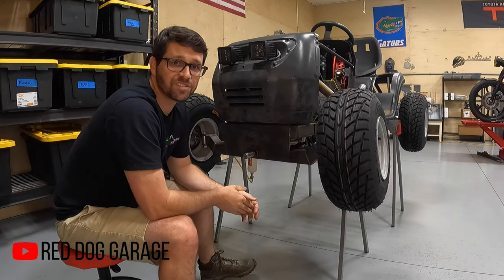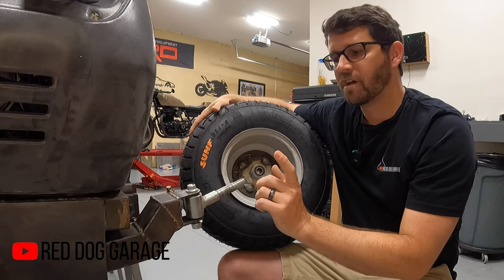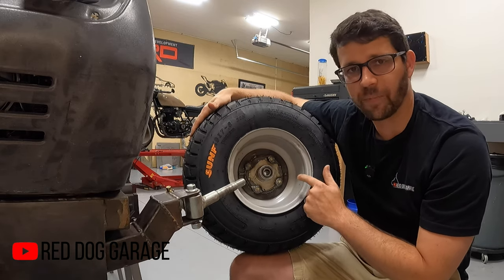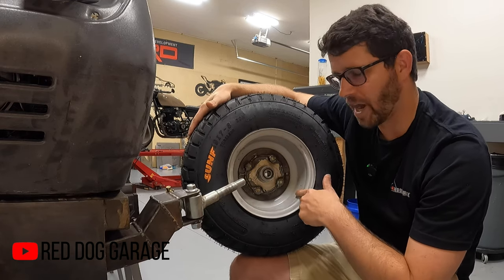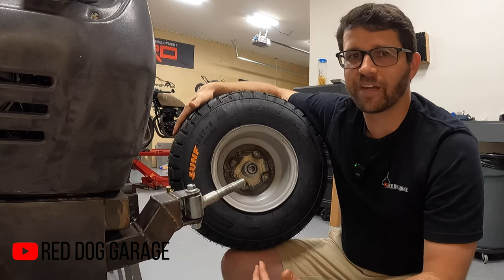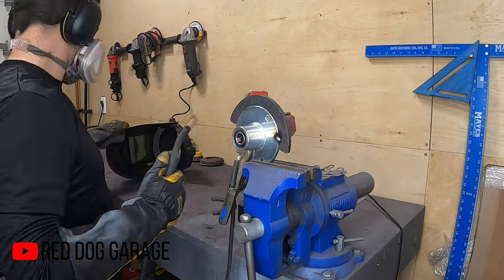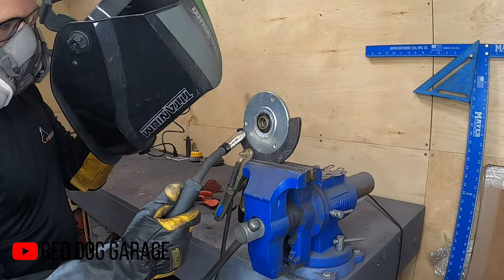Now of course there is the matter of the front hubs. Pull these off and you can see there's a front spindle that is welded onto that front axle. This front spindle came with hubs that had a three-hole pattern that didn't match up with the four-hole pattern that came on my wheels. I could have just drilled the three-hole pattern right into the wheels — that would have been the fast solution — but I decided to go with actually cutting out some pieces on the CNC plasma. That allowed me to weld an expansion onto the hubs themselves and then drill the proper four-hole pattern. I then welded in studs for the wheel lug nuts that match the rear.